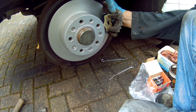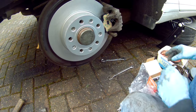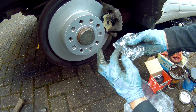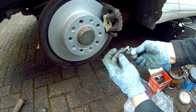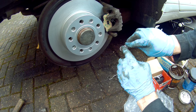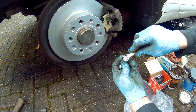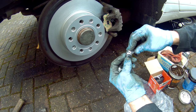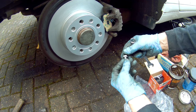You've got to push these pins in slightly to get the caliper in, hold it and then put the nuts on. Usually with the brake pads you get a set of new nuts with Loctite on, so always fit these and always fit them to the correct specified torque. They're quite shallow bolts. I wouldn't recommend a 12-sided ring spanner — you want a six-sided ring spanner that fits perfectly, as the 12-sided ones tend not to grip as well. Whatever you use, make sure it's on fully, otherwise you'll round these nuts off and it becomes a difficult job.